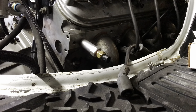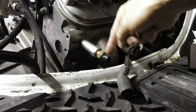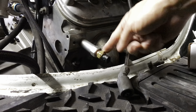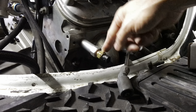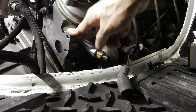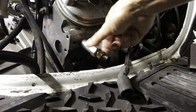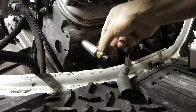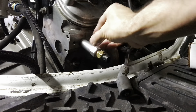This is something you may encounter if you're putting an LS in an older vehicle. A lot of people like to run regular hot rod type gauges, which is what this sending unit is for. But the ports on an LS are metric, so you need to get an adapter to use the old hot rod type temperature sensor or oil sensor with an LS.